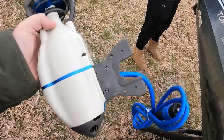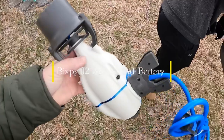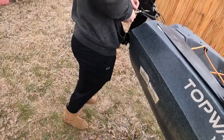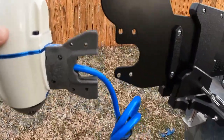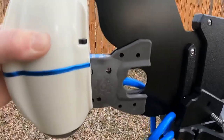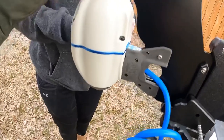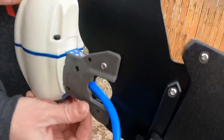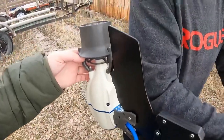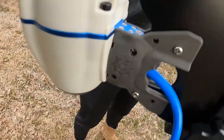The Sniper Air Industries rudder is now installed. This is the Bixby jet motor connector and I'm going to connect this to that rudder. This rudder is made for this easy attachment, which is super nice — those holes line up there. I'm just going to put those in. We also decided to add some Loctite before finishing putting these back on.